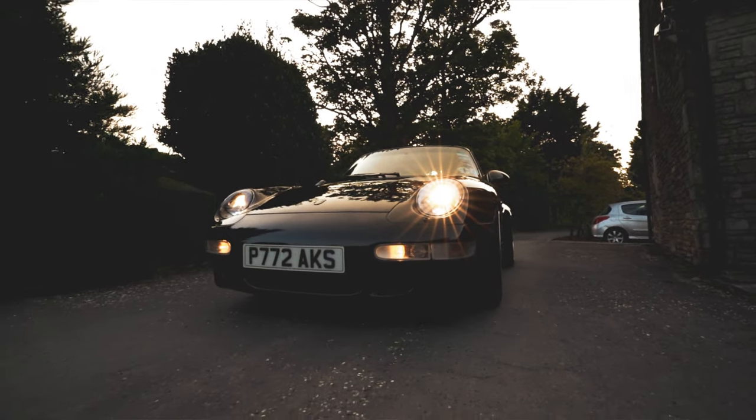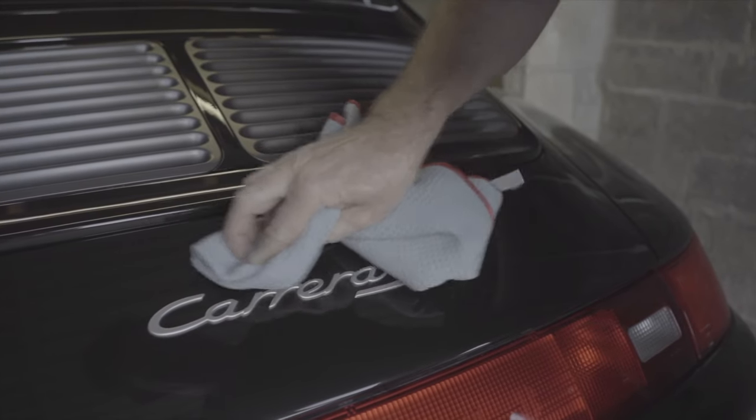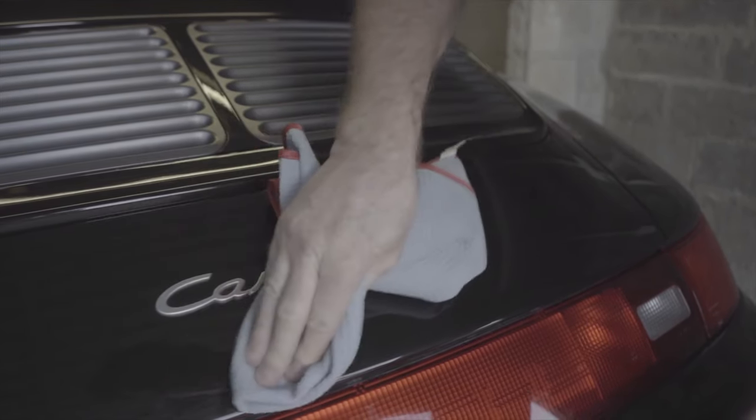It's a good feeling — it adds to the driving experience of the 993. We've got a bit of an open stretch of road now, so just opening the car up a little bit. You can hear the car howl — especially when it gets over 5,000 revs, the VarioRAM system is engaged. Previous to 5,000 revs it increases and improves induction. I talked about the VarioRAM in one of my earlier videos — please see those below for more details.